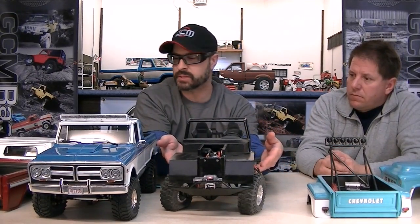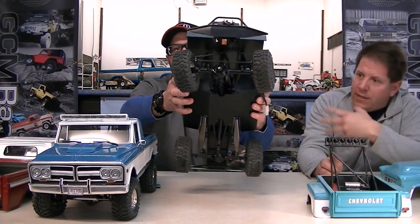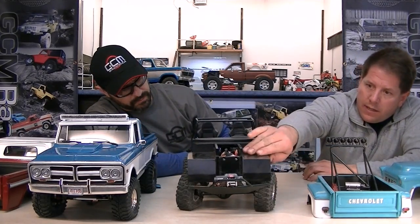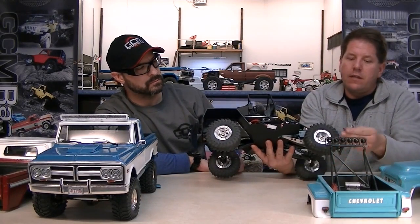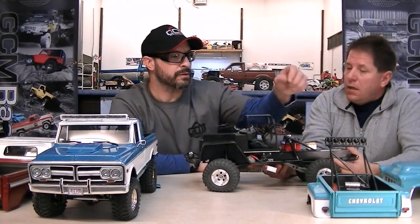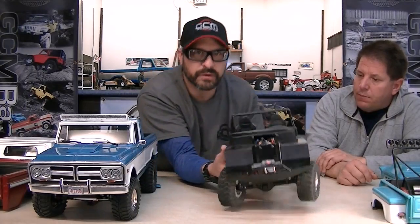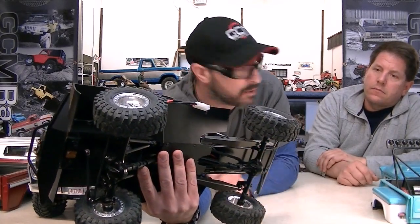Your fenders — you seem to have tubbing in all of them. Those are my skid plates — so when I do take them on the trail they slide off rocks with nothing to catch. They're 16-gauge steel. The inner fender wells are just styrene, and I put a full cage underneath all the way to the back just to protect the body. Once my body is on I want to protect it as much as I can — if a rock comes up I want it to hit the frame instead of the body.